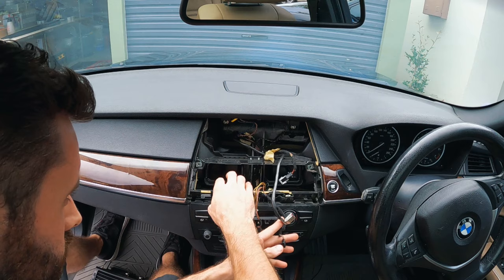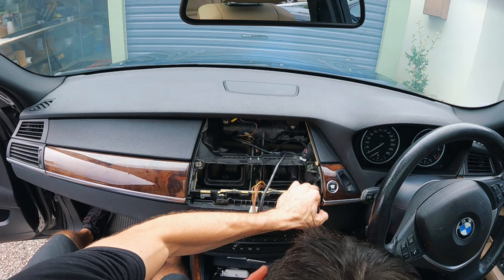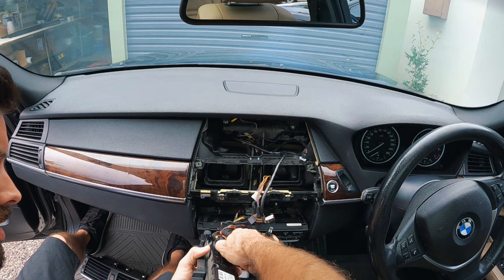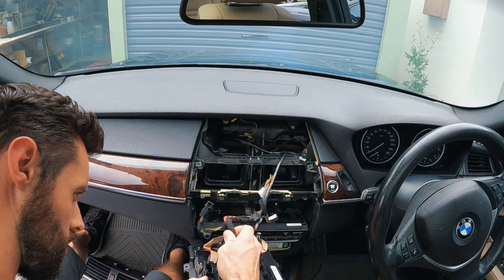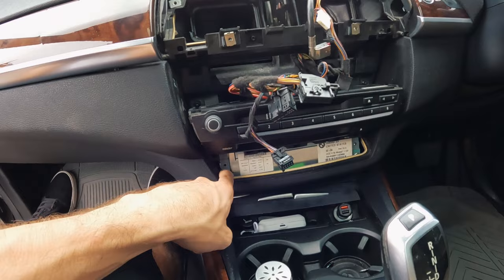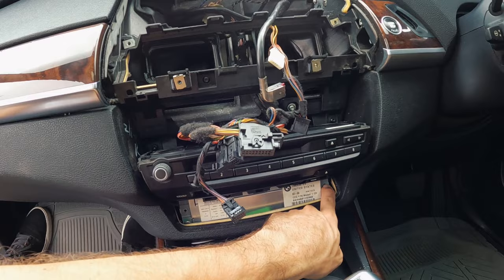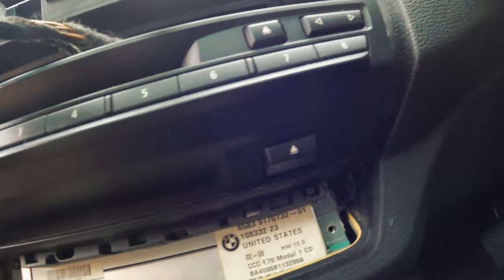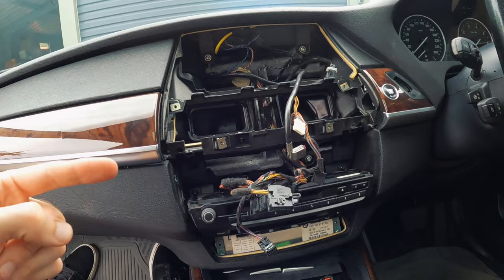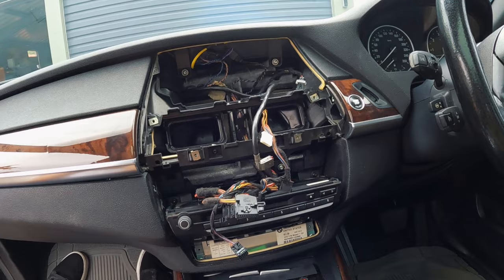Then we'll remove the AC panel and unplug everything. I've brought you down to show you some hidden screws that I couldn't see at first. In the Android instructions it said there are two screws down here, which I've pulled out, but it would not budge. If you get down really low, you can actually see there are another two on either side — so there are actually four screws down there holding that unit in. I'll pull those other two out, and then hopefully be able to remove that entire unit and unplug the car's factory harness to plug in the Android adapter.